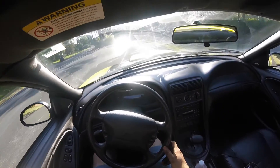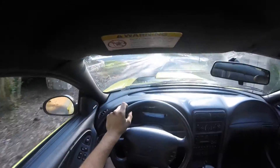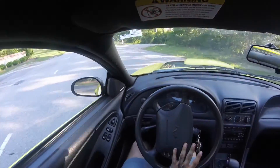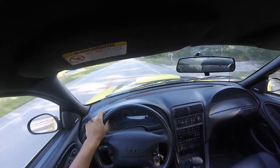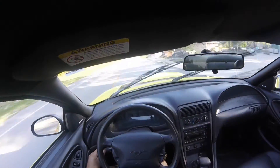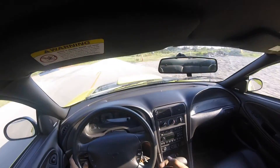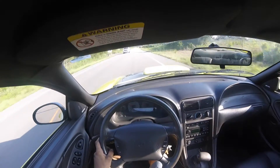Just got the car running good. When I first started it there was a misfire, but that was probably because I had a little bit of air in the lines mixed with carbon build-up, and it's also been sitting for about a week. It idled terribly with blowing smoke at first — that's probably because of all the air in the fuel line — but now it's probably idling the best it's ever idled. Got the new race tune in here; it's my weekend driver, so let's try it out and see how it does.